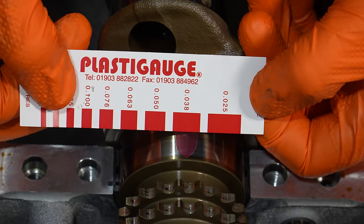This one is going to serve as a guide. The seal needs to sit flush with the inner lip, not the outer one. Now we can install this M6 screw fully — the torque spec is 10 Nm. Measure all around to make sure the seal is seated properly. That's the front crank seal installed.